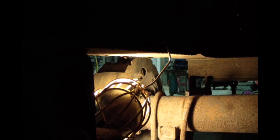Alright, in case you're wondering, this is one of the Diablo carbide tip blades. They work really well. This is some hard metal in itself, but this blade is wore about out. We used this blade to cut some bearings out of our skid steer. Our oxyacetylene was down, and we didn't have a way to get any oxyacetylene at the time on the weekend either, so we ended up using the carbide tip blade there, and it actually worked pretty good. It took a little bit of time on a hardened bearing. Those things are extremely hard. But I was pleased, but it pretty well wore that blade out, and I'm still using it. I need to go buy a new one. They're definitely worth the money, I'll say that.